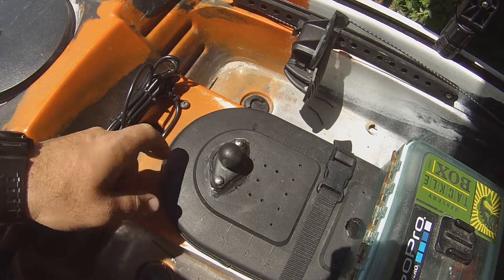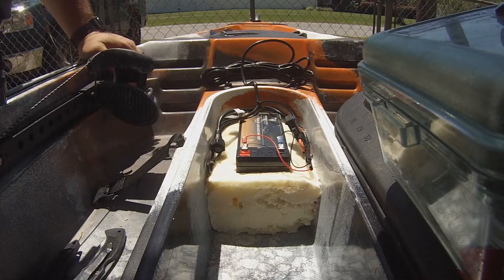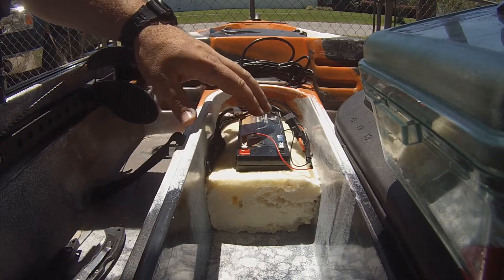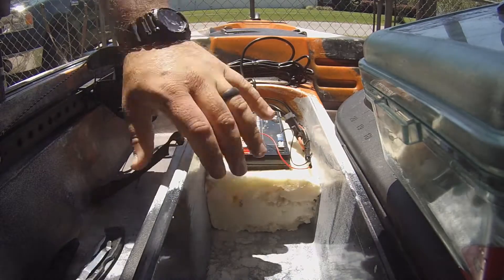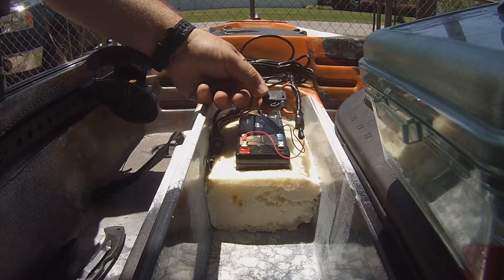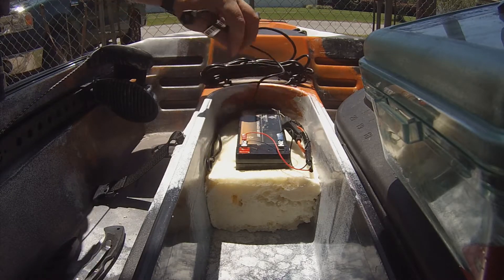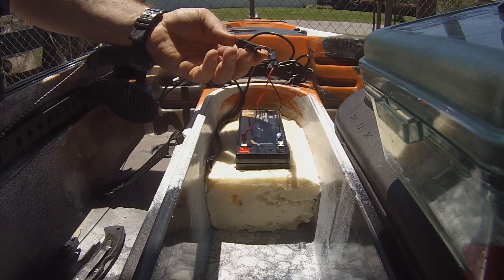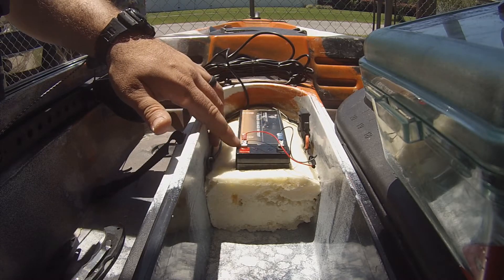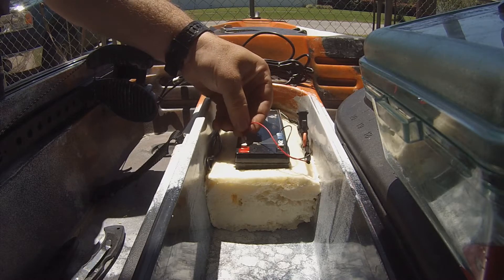Let's see how I put the battery in the kayak. This is how I'm currently running my battery setup. I'll leave links in the description — I got most of this stuff from Tractor Supply but I'll find it on Amazon too. You do have a fuse — you're going to have to run this on your red wire from your bundle. You're going to want to put a fuse in-line with that red wire and get some quick-connect snaps for your battery so you can take them on and off quickly whenever you need to charge.